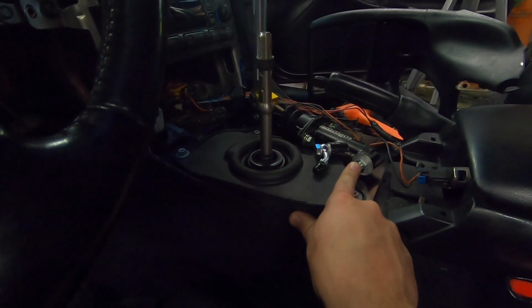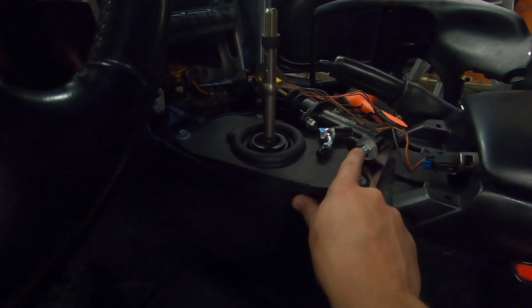The 7/16-20 is the shorter of the 2. That's going to go to our factory master cylinder. So they're going to run right next to each other. I'm going to zip tie them up right in front of the pedals across here, and then where we're going to punch through the firewall is that existing hole right there. So that's where the factory hood release cables go through.